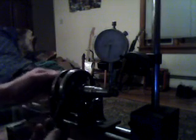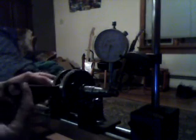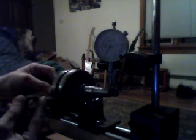So what I'm doing, the reason I call it the Quadrant Method, is I'm going to take it in quarters. So basically I'm looking at that. Now that is currently at -1. Then I go there, I'm at a little over 0. At the bottom, I'm actually at positive 6. At the back, I'm actually at 4. And then when I get back up to the top, I'm at -1. So let me re-zero that. And let's do it again.